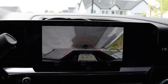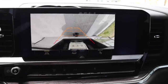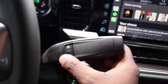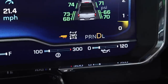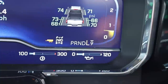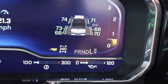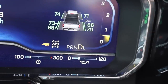Unfortunately my truck does not have the bed view camera, although it should. You do have these lines if you are hooking up to a conventional hitch, and you can do a bird's-eye view too. You can shift down to L — this is the gear limiter, so you can limit what gear you're in. This truck has a 10-speed transmission. This is good for declining grades — if you want to lock out 9th or 10th gear, you can do that so you have more torque in each gear. But honestly, having tow haul mode is all you really need.